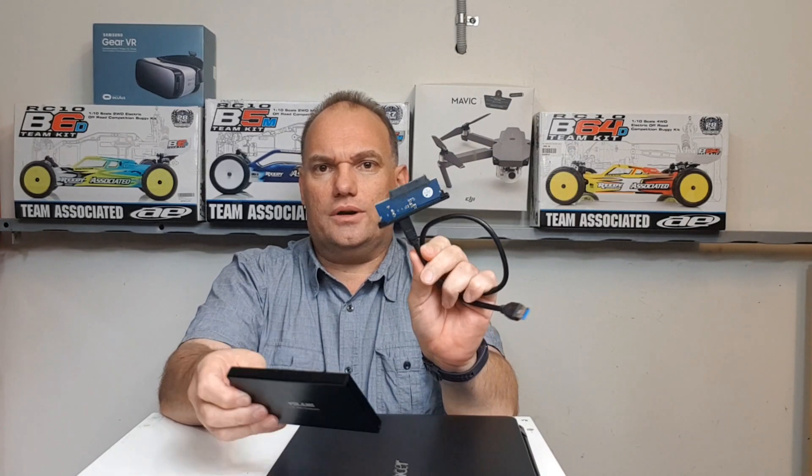What's in the laptop at the moment is a 640 gig drive, so there's a bit of a difference. What you need to do is buy one of these little cases. All I'm going to do is take the hard drive out of the laptop and put it inside this case, so you still have that extra storage and just have essential programs on the SSD. Some hard drives you buy come with software that transfers everything from the laptop to the SSD, but you'd need a bigger SSD than the current drive for that to work.